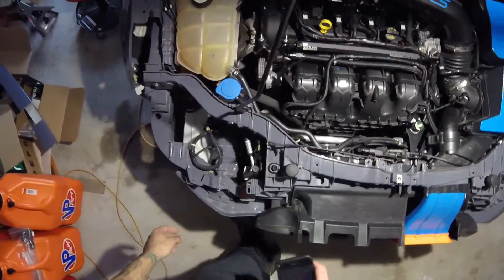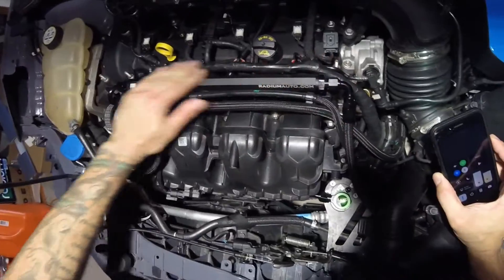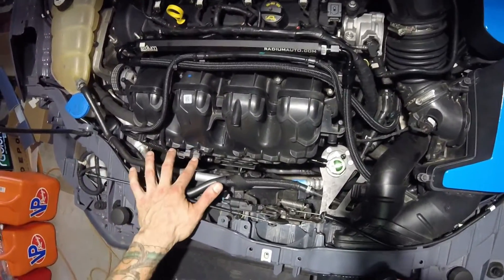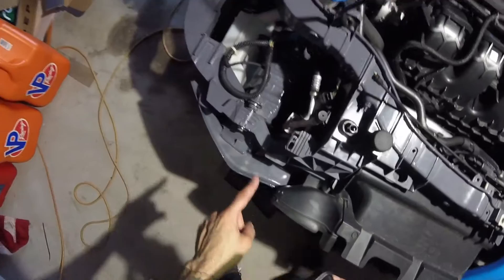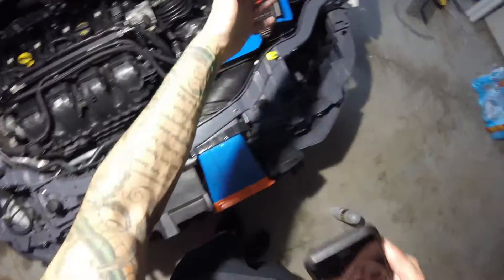What I have to do is replace the sensor right there on top of the intercooler. I'm going to replace this sensor. And then I'll have to cut into this electrical wiring here and basically take the one wire from the split second that is triggered by this, reconnect this line to its stock configuration, and then tap into the green wire with the brown stripe. That is now going to be what triggers the split second.